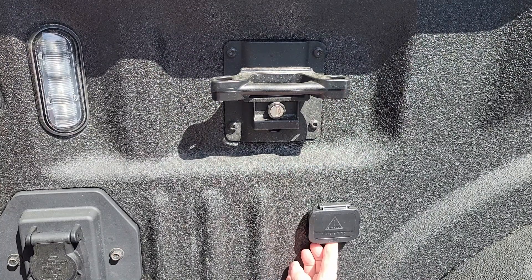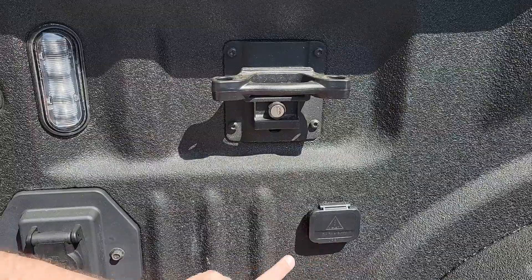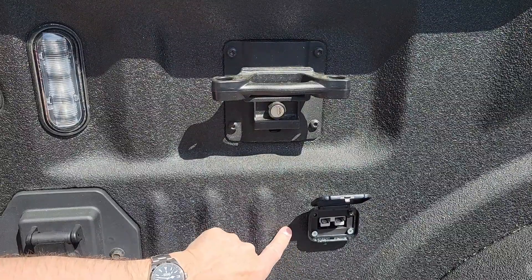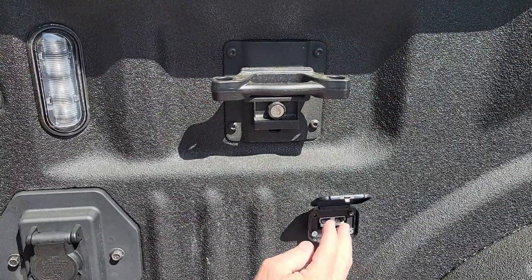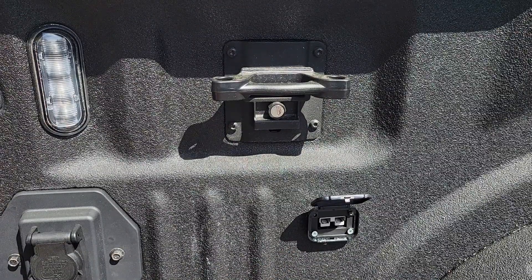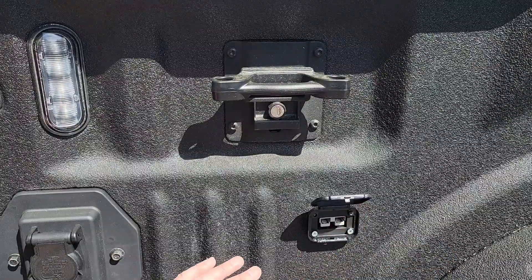This is how I mounted the Anderson plug connector in the bulkhead of the truck. I wanted it to be as close to the seven-pin plug as possible. There are three ribs here in the bulkhead and I had to go over this far because there's a support right here inside the fender well. What I did was put the terminal pins on the ends of the wire, took a piece of bailing wire down through and pulled the wire up, plugged the pins in, and then mounted the Anderson plug in the bulkhead. I started from the rear and worked forward because when I got into the engine compartment I was going to have to cut the wires to different lengths and didn't want to end up too short.